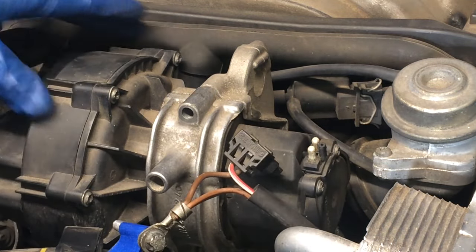Okay, I'm going to pull that out. Here's our old hose. To size it, look at the end that's the smallest — since this is the same diameter hose the full length, one side has stretched out a bit from being at that angle on the MAP sensor, so measure from the smaller side. It looks like this is 3.5 millimeter inside diameter. I've got some 3.5 here — you can see that's the same inside diameter. Outside diameter is a little bit different but that's okay; inside diameter is what we're looking for.